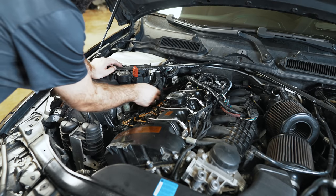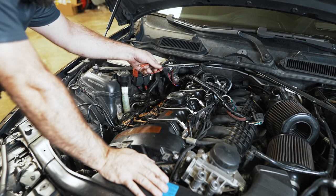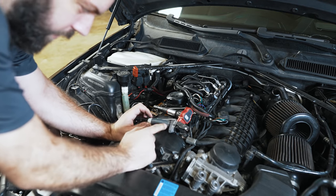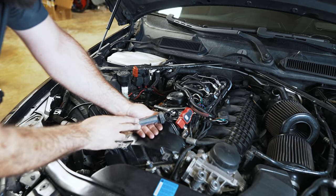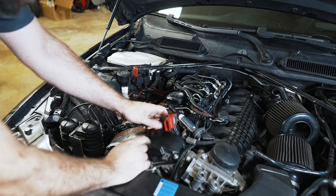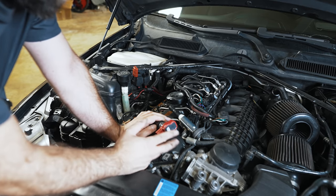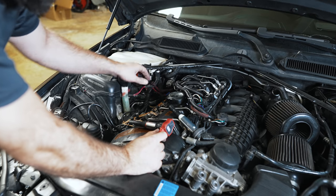I'm disconnecting the power source for these coils - that is what made these different. They could take power from the car and feed the coils. This is a standard ignition coil, actually from an N20, but the same style would apply to an N54. With a standard coil you only have so much area to store spark energy. But what Audi did is use four pins - they take power from another source, and the signal from the ECU is just a relayed trigger.